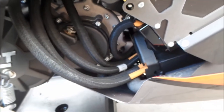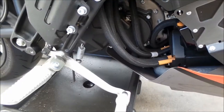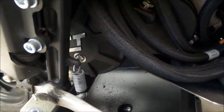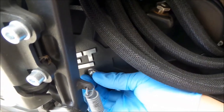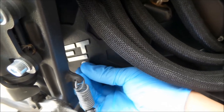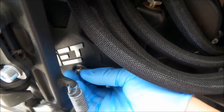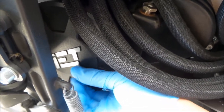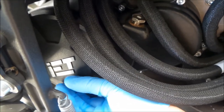Right here is the level checking plug. Go ahead and take out the level plug — it's in there quite tight. It's kind of hiding behind the foot peg. Just take it out all the way. Make sure you don't lose that washer. Oil should not be spilling out if the level is correct. I've never checked it before. It's quite a bit of threads too.